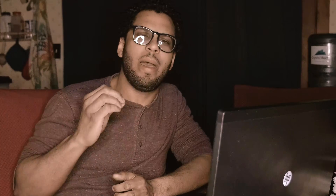Another thing I'll add regarding the graphics card: in terms of which brand you choose, whether AMD or Nvidia, I have no real proof of this, but based on my experience when I got eGPU working, it seems that you should try to match the brand of your eGPU graphics card with the one that's internal in your notebook. My notebook had Nvidia internally, and Nvidia cards worked with it. When I tried an AMD card, it didn't work.